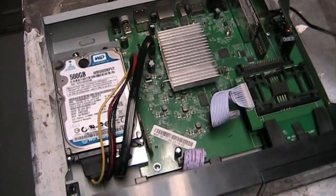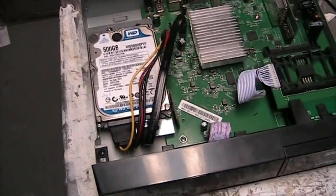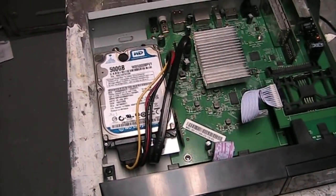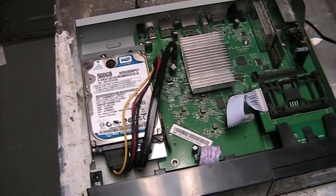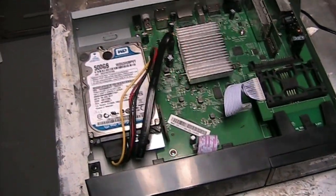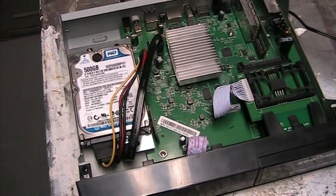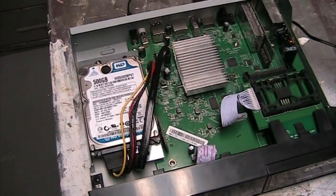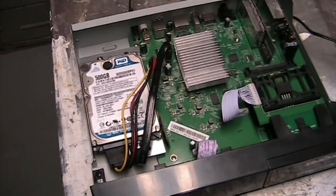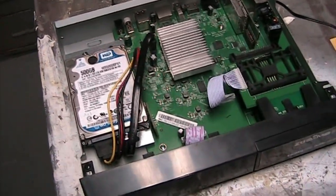Because this is a 500 gigabyte hard drive with all sorts of videos on it, it wouldn't play TS files — recordings from my home PVR for over-the-air stuff, and also VLC recordings from my HD HomeRun. It wasn't playing the MPEG-2 TS files. They are MPEG-2 files but their extension is TS, so the stock media player just might not be able to read that.